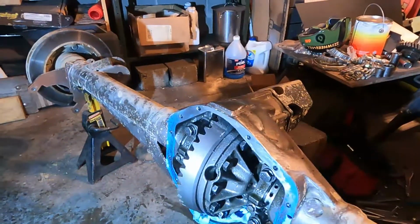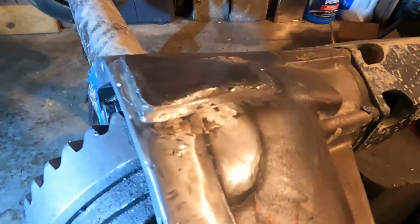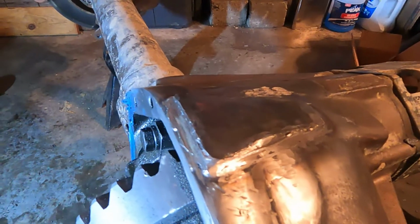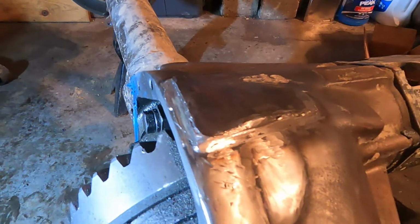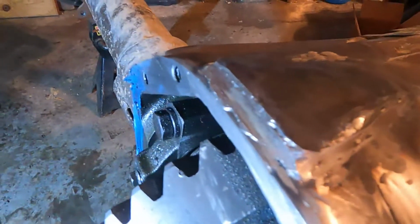But anyway, guys, I got the first plate on. Now this nickel welding rod doesn't exactly run the best. It doesn't run like 7018. It runs more like stainless. It's very hard to read the puddle, and it is what it is. So anyway, with the preheat on here, start running a fillet weld around the perimeter of each plate piece, and then grind it down so you can slide in the next plate piece next to it, and then you'll put a second pass on it.